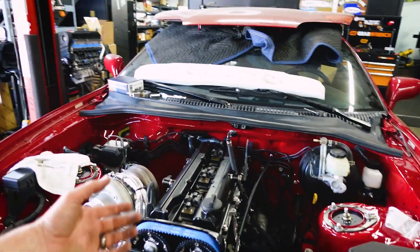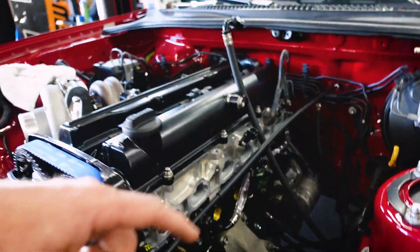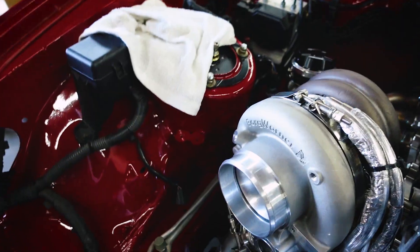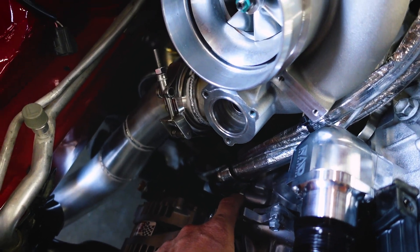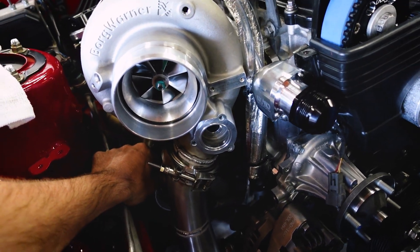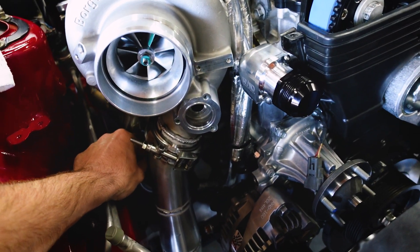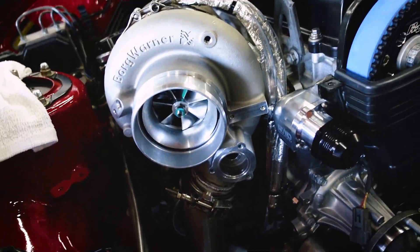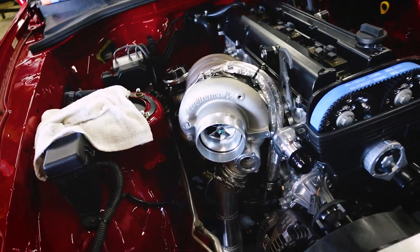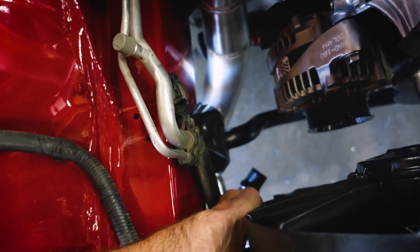We've also been doing stuff with the Hypertune - some plumbing. This is the water feed to the turbo. It goes around the back of the block, comes up, feeds water to the turbo, then the water returns into the water pump. We made a stainless hard line for the turbo drain - it's not tight yet because we're going to take the turbo off. We've got to powder coat some stuff as well. We have an oil feed line for the turbo. Soon we're going to build some dash-20 Pro Plus XRP fittings for the upper and lower radiator hose.